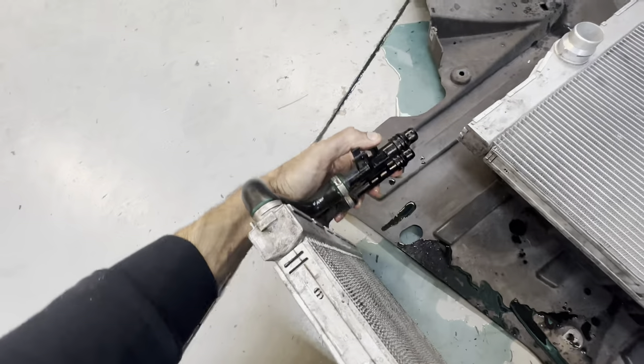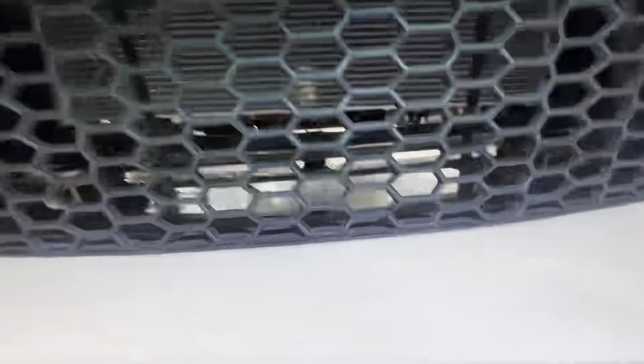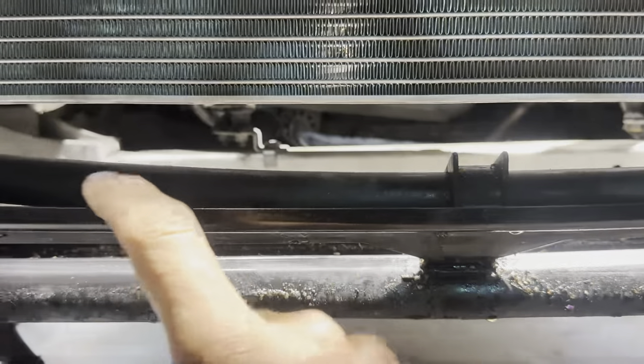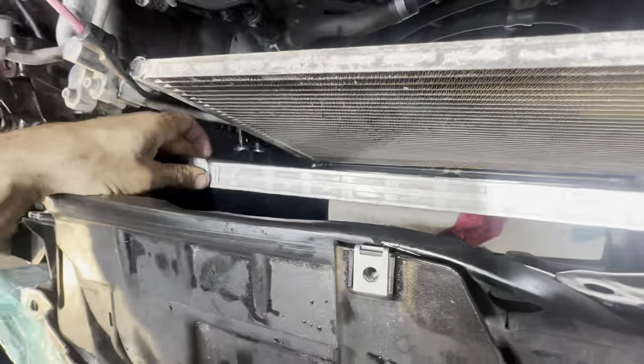The radiator is in and in place. On the bottom there's going to be this hose — that's the hose where the clip is right there. You just reach under, clip it in, and there's going to be a tab on each side just to hold it in place, so make sure it's nice and tight. Here's the auxiliary radiator — the new one that was broken — it's in. Just carefully maneuver those lines in, then there's going to be a hose along the bottom.